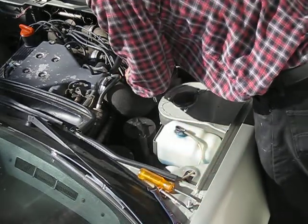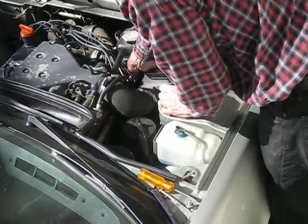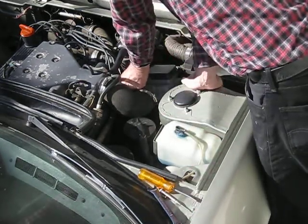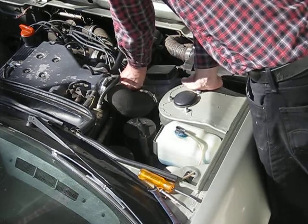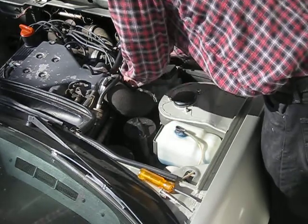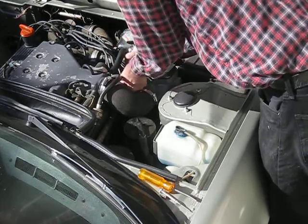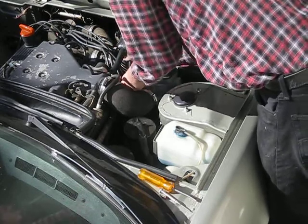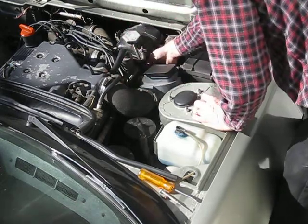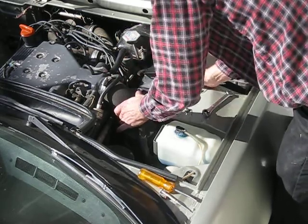These two should go in if you've gotten things lined up pretty well. Sometimes you have to wiggle around to get this in, but it seems to go pretty well. And this last piece here is always in the way of the spark plug wires. It's okay. So let's tighten those up. Get snug. Tighten this one up. Just snug. Now's a good time to put the connector on, because believe it or not, if you forget, which I do a lot, it doesn't work.